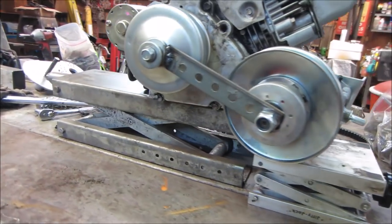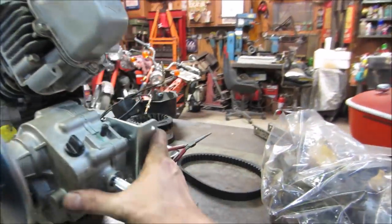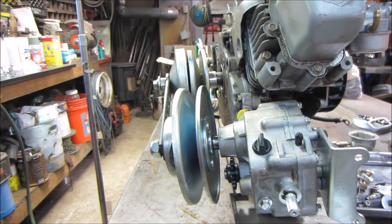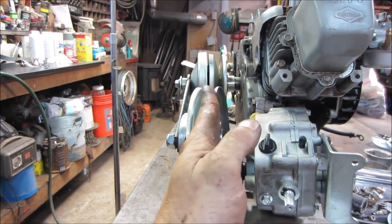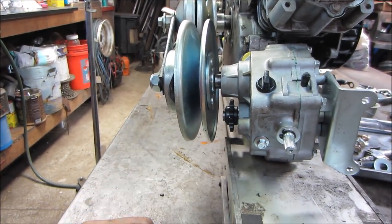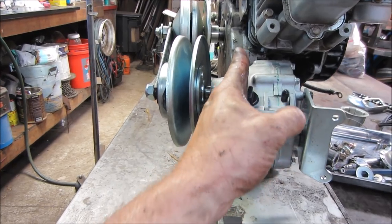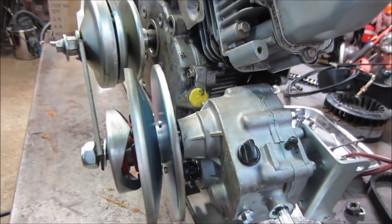All right, so I got a couple of table jacks out there so you can kind of screw around with the height of things. And when I put the front clutch in, they come with shims that you can move the thing outward if need be. I was hoping I could kick everything over so that would put the sprocket more over this way to catch the bottom one that is on there. But it makes the gearbox part of it start lining up with that part of the case. It can't tuck in like it did.